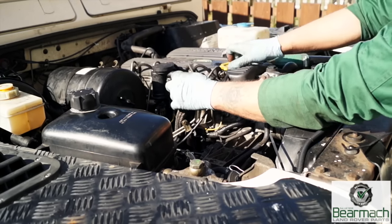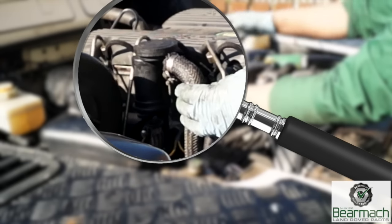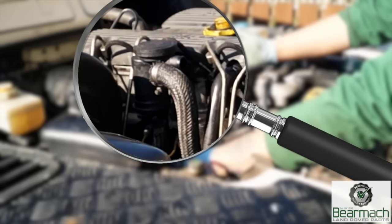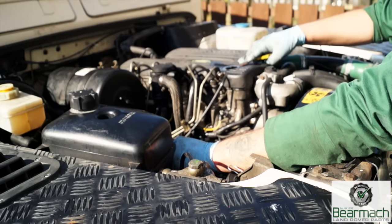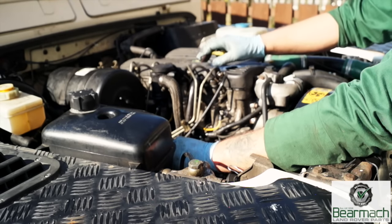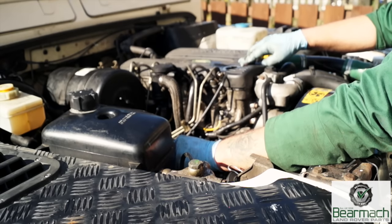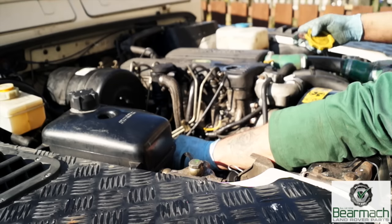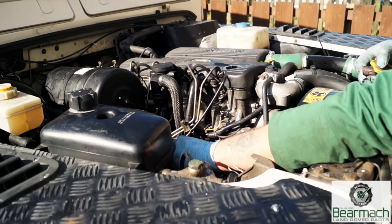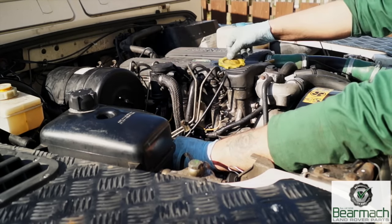Basically with the 300 TDI we have an oil and air pressure separator, which is that black thing on the side of the engine. When you want to check for pressure in the crankcase, the best thing to do is to see if there's pressure and fumes coming out of the top of the oil filler. This will be a good indication of worn piston rings and worn cylinder bores. If oil is being consumed quite considerably, then this is a good sign that oil is being burnt off in the cylinders.